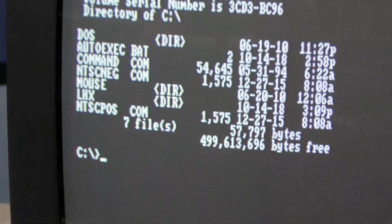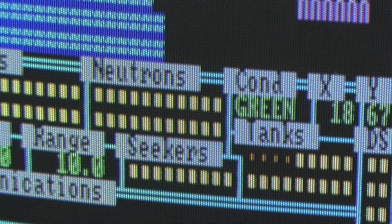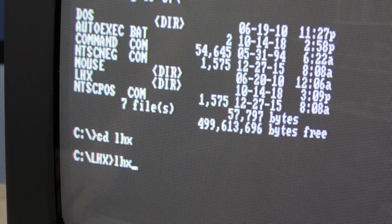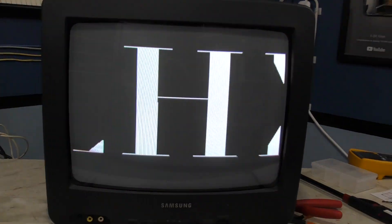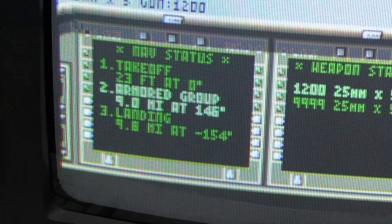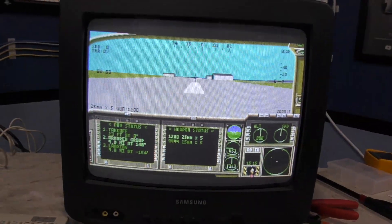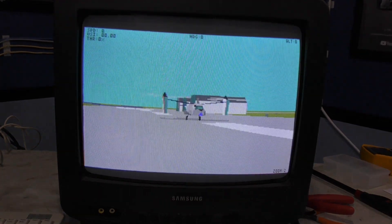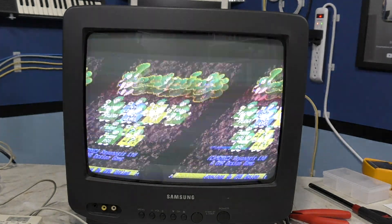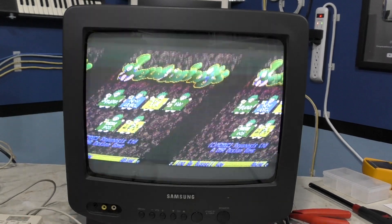It is in full color, and most any text-based program should work fine like this. But what about games that use graphics modes? A lot of games will work just fine — LHX is a good example of one that works flawlessly. Everything is perfectly readable, which makes sense since this game is only running in 320x200 graphics mode, which is plenty easy for a TV to display. However, let me show you what some other games do. Starting up Lemmings, everything goes crazy, because Lemmings obviously fiddles with the timing of the VGA card, and there's no real way around this — it just flat-out isn't going to work.